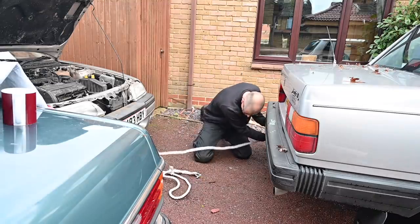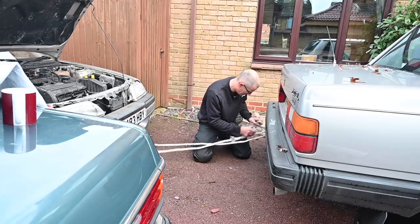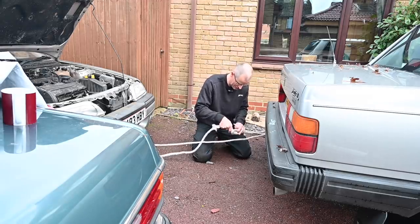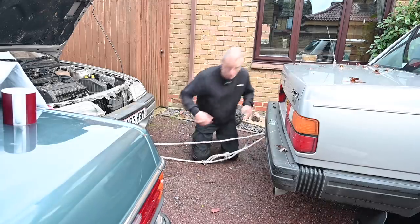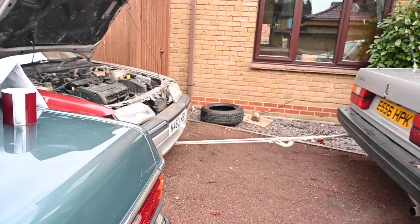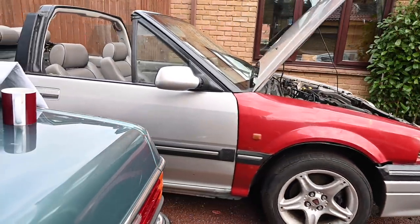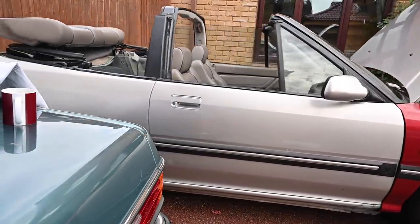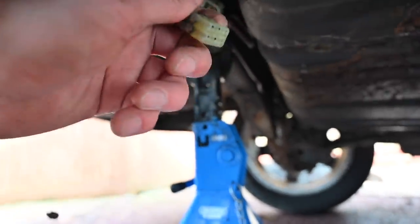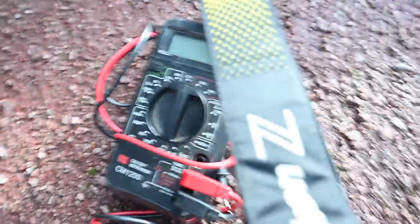It's the first time I've used a Volvo as a tow hitch. I'm hoping it'll go well. Fortunately my neighbour, who often parks across the entrance to our drive, is out at the moment. I can go straight forwards, otherwise I wouldn't have a hope of doing this. I'm just about scraped by with the Tomcat because I can go sideways, but the Volvo is so long. With the exhaust off, it's actually quite easy to reach through and see this connector which goes to the front of the car, so I can stick my test meter into those pins and see if I can get any voltage.